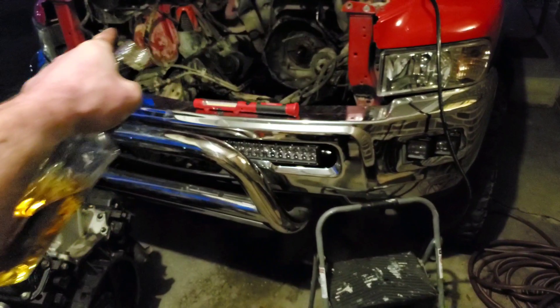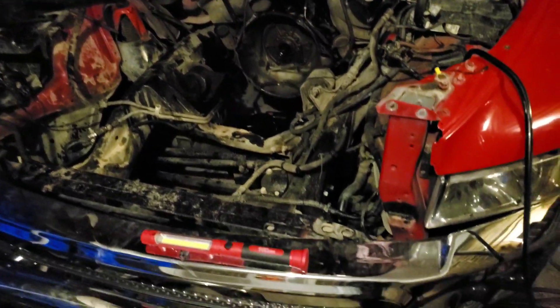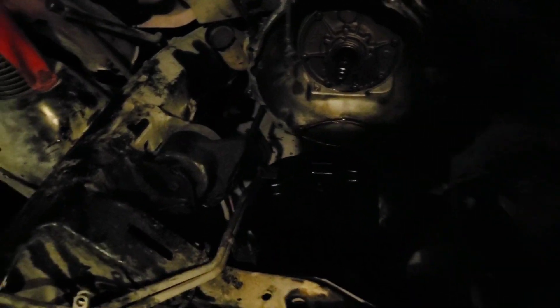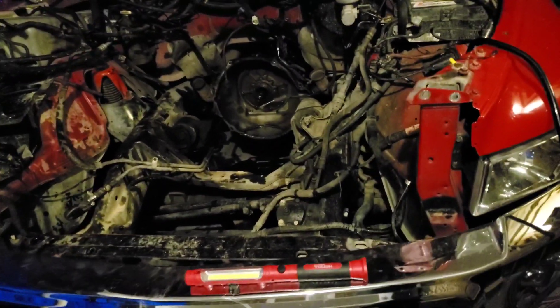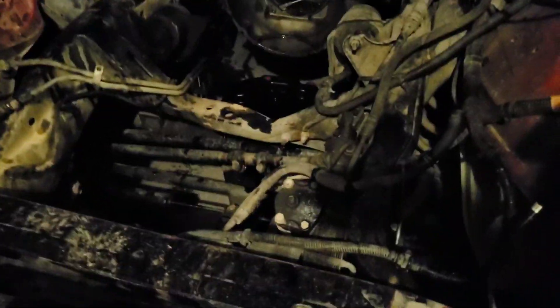I'm going to pretty much call it a night. Tomorrow I'm going to have to come out here and spray off all of that — it's dirty, it is so dirty in here. I'm going to go ahead and tape up all my plugs, anything that I think will get wet, and block off the bell housing because I don't really want to get water in there. I'm going to come back out here tomorrow and clean this up again because that mud's starting to cake up. I haven't power washed it or really done anything to it in like three months — haven't sprayed underneath the hood.